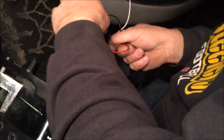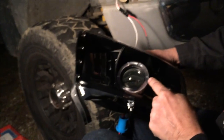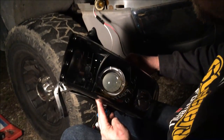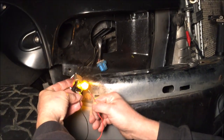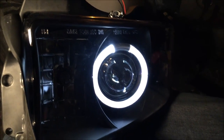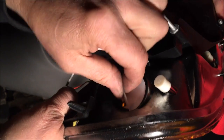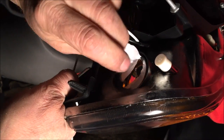They're on! All that wiring we just did was for those three lights. There are two wires on the bottom of the light - a black and red one - we had no idea what they go to. We connected those two unknown wires into the running light circuit again and it turns on the halo around the headlight. When the light is shipped from the factory they put a sticker over the back to keep moisture out - that's where your original turn signal bulb goes back in. That looks sweet. Running lights and halos on - turn the main headlight on!